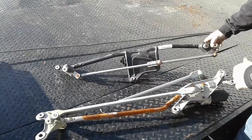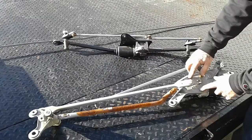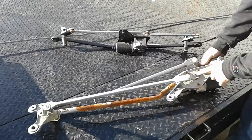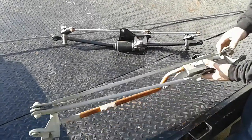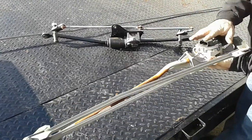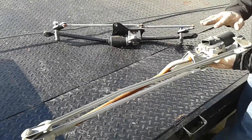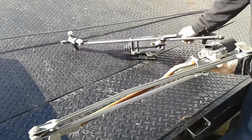These are your three factory bolt holes that hold your motor on to the back of the linkage, and this one holds your wiper arm on. What you're going to do is unbolt these three bolts and take your original motor off. You don't use the motor from the new linkage — you use your original motor. This will save you wiring problems.